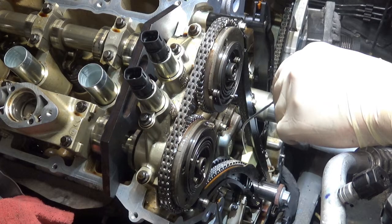You'll start like you would on any other one of these jobs — disassemble the engine, rotate the crankshaft over until you can get the cam locking tools in, which I've done here. You also take a paint pen and mark the links where the phaser marks are.